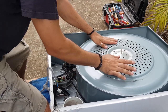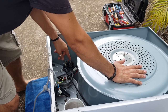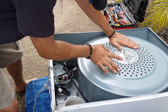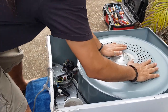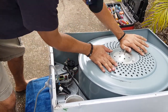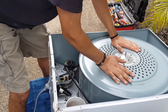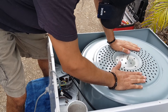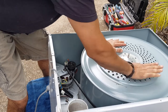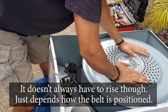What that does is it seats the belt, because the idler is able to move up and down on that pin that it's stuck on. It moves freely up and down, so it's just positioning itself nicely, and that looks pretty good. But remember, these dryers actually stop and go in the other direction, so we want to do the other direction as well. And automatically you see the belt start to rise. And it's still working, it's still going good. So I'm quite happy with that.